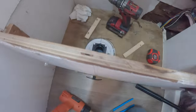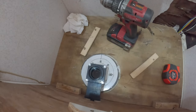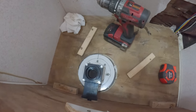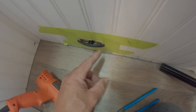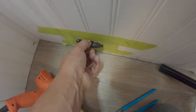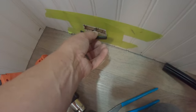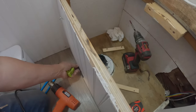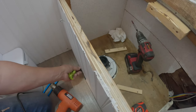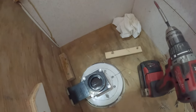I have the valve in place, the cap on the tank siliconed back down and screwed in. My only issue is the curve of the arm — it closes but doesn't quite close all the way and springs back a little bit. I could take off more material but then it might be hard to grab. So I have a heat gun here — I'll try heating it up and flattening it or even reversing it a little. The heat gun worked perfectly — it's a little bit hard to grab but not bad, and it closes all the way and stays closed.